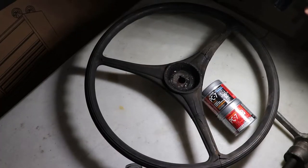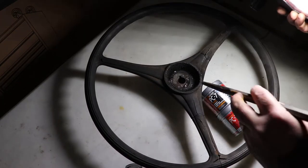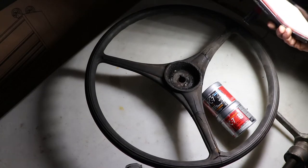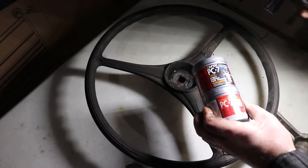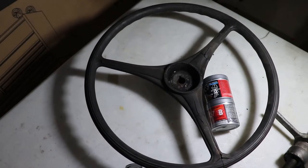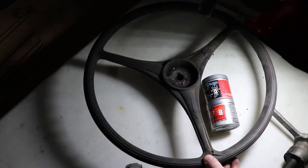You can see the center of the steering wheel where I hit it with the drift in a number of different locations — that worked out pretty good just to shock it the last little bit of the way. You can see it's charred a little bit; it's actually quite flammable. As soon as I brought the torch near it I knew I was going to have a problem. I've got some PC7 from Eastwood, which is supposed to be an epoxy for preparing steering wheels. This steering wheel seems like it's made out of rubber considering the way it started to burn. I was thinking it's going to be bakelite and asbestos, but perhaps not — I'm going to be careful and treat it as if it is made out of asbestos, because a lot of stuff from this era is.